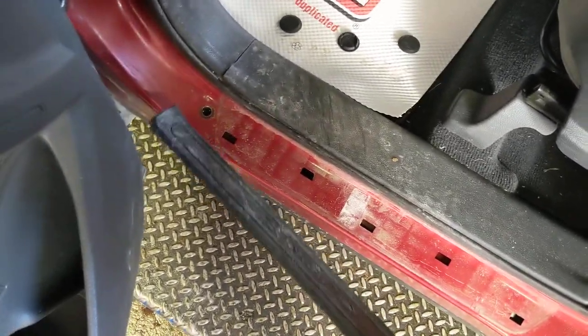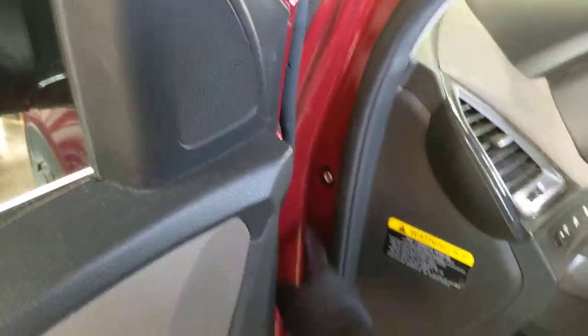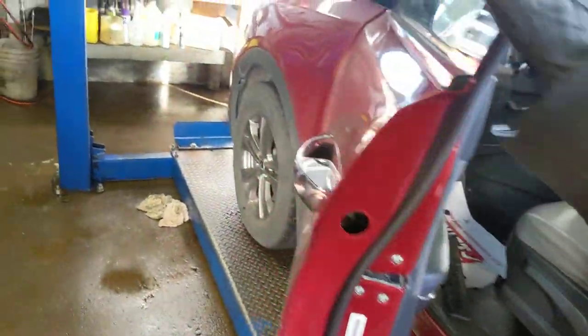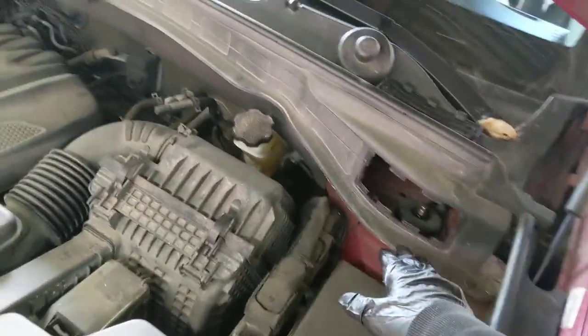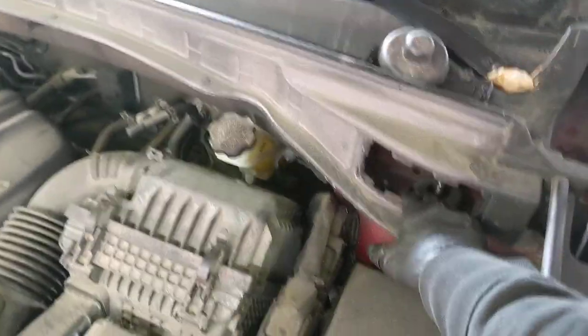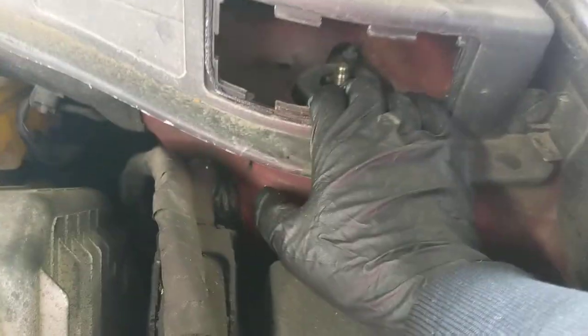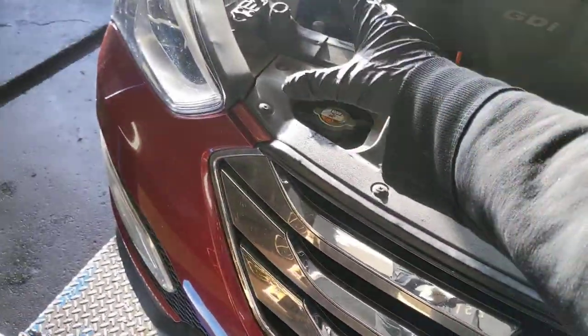There are two factory holes here that I can use to access the front pillar. A little annoying to say the least — I always see the same routine with vehicles that have been sprayed elsewhere. But I should be happy because they wind up here with me. In this case I take the top of the strut covers off — plastic covers — and spray that, because everybody knows the top of these struts will always rust out eventually, so I like to spray those.